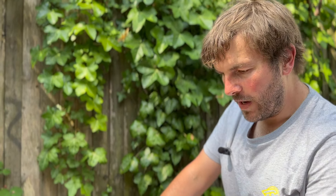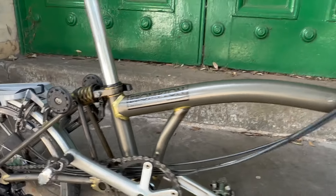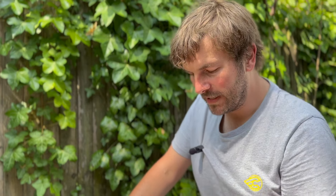As you go through the bike, you also want to check if there are any problems with any welds. This bike has a clear lacquer finish, so it's very easy to see any imperfections. Most Bromptons are powder coated, which is a great hardy finish, but if there are any issues they can sometimes be masked because the problem can be under the powder coat. So if there's corrosion under the powder coat, you may not see it. It's good to have a feel around the paint, see if there are any bubbles or cracks — just have a good glance over the bike as you go through it.